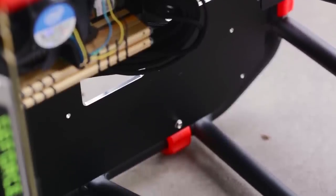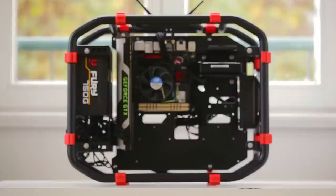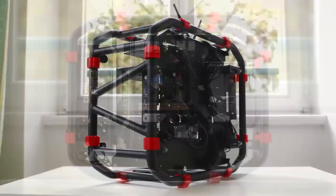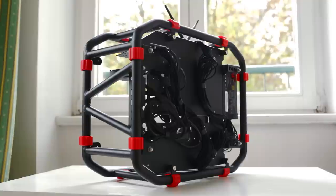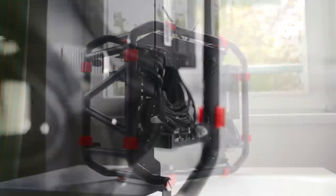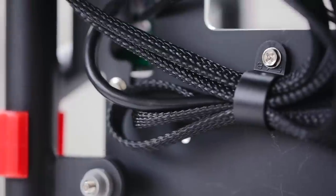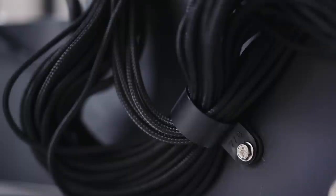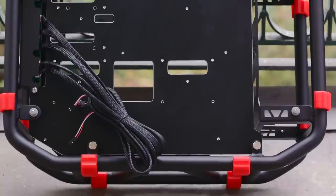Overall, I'm actually quite happy with how this turned out, but I did remove the fan bracket at the bottom, as our motherboard only has two fan headers, one of which is already occupied by the CPU cooler — and that's something you should keep in mind when considering building inside this case. Getting things prepared behind the motherboard tray was also a bit tricky, as you have to make sure the cables are as flat as possible to avoid any bending on the glass panel. In-Win does supply several large and small plastic loops that you secure to the case to contain the cables — that worked beautifully, as you screw the hoops in place with no need to glue anything, avoiding unattractive cable ties. The problem was that not all holes at the back of the motherboard tray are threaded, which limits some areas for cable routing as you can't secure them to the tray.